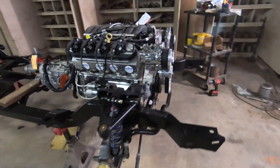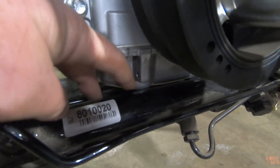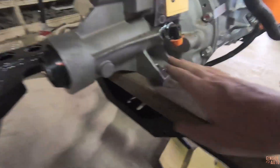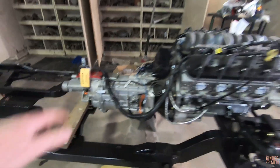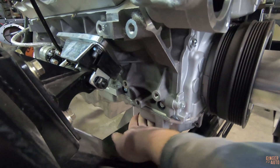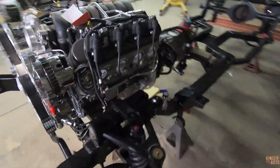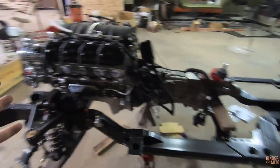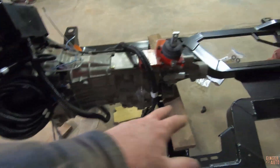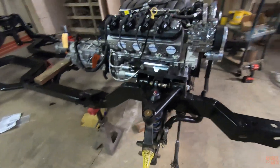Everything fits perfect. We were a little nervous there for a bit because the oil pan is sitting kind of on the rack and pinion. But then we realized we still have the back end mounted up just because we don't have a transmission mount yet. Once you lower that three or four inches, that's going to clear just fine. Other than that, the clearances are perfect — this frame was made for this engine and transmission setup. When you select the options on the frame, you tell them what engine and transmission you're planning on using, and they build the mounts around that.